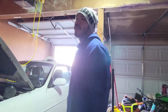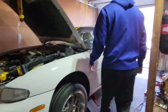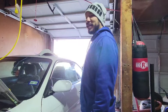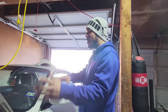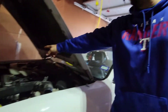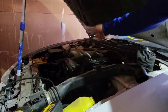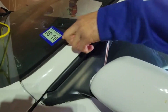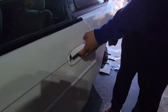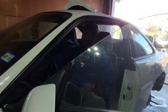What's up guys, back with another video. A couple of y'all were requesting an update on the 240. Basically what I did was I found the fuel pump that fell inside the gas tank and it shorted out. I changed the fuse, put in some new spark plugs, did an oil change, new belts, and she cranked right up. Look at that — 2016, yeah, she'll crank up.